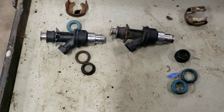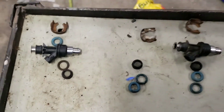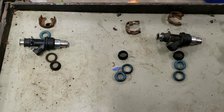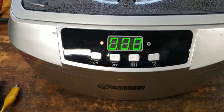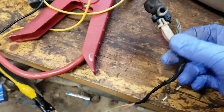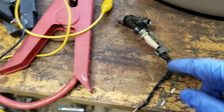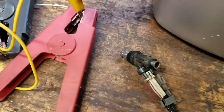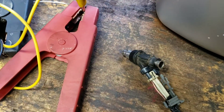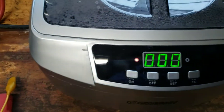I know this is just the exterior, but I'll show you what I'm doing and how I'm checking the spray pattern. I've got a pigtail that I pulled off my donor — kept the wiring harness in case I needed anything. You could also use alligator clips. Just 12 volts off a booster box. As I have it inside the cleaner, I'm just cycling it — you can hear it and see it actually spitting a little bit of fuel. I'm doing that as it's in the ultrasonic cleaner so it will hopefully get some of that gum off.